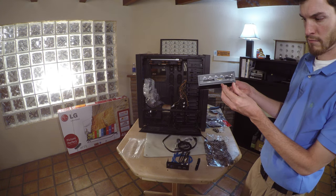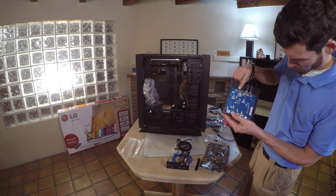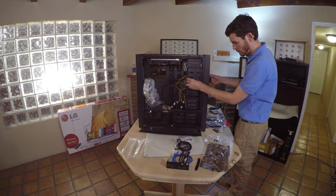This all-in-one card reader and USB controller has an eSATA port. Configure all of the cabling necessary, and then add it to the 5.25-inch slot, accommodating the rest of the drive space.